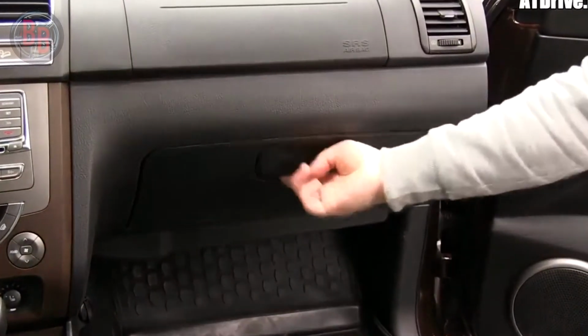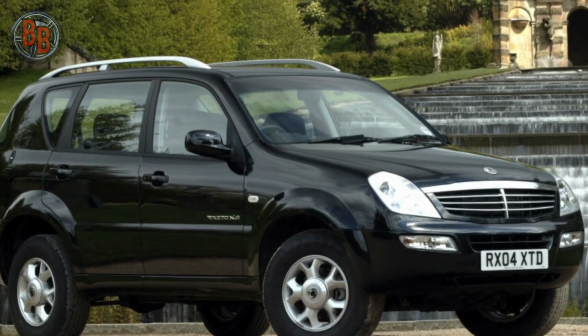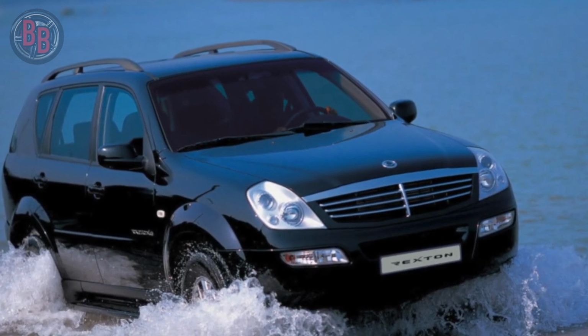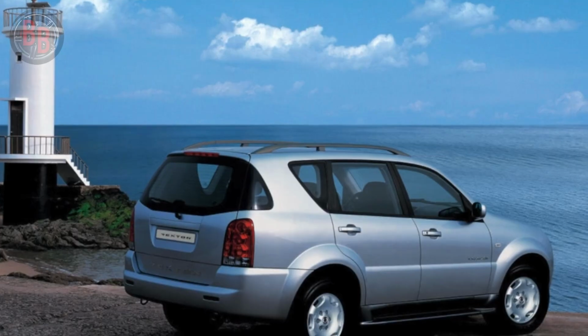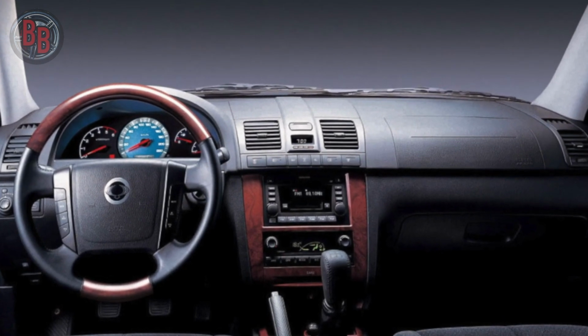This box is a copy of the Mercedes 722.6 automatic transmission, so many parts are interchangeable. Its disadvantages: oil leaks, failure of the control board, contamination of sensors and filters. To prolong the life of the machine, every 60,000 kilometers a preventive oil change should be carried out.